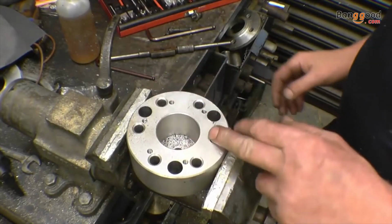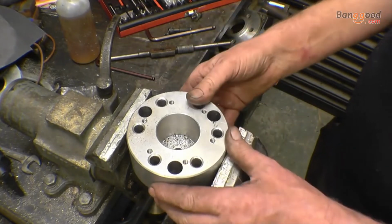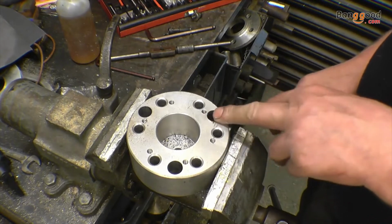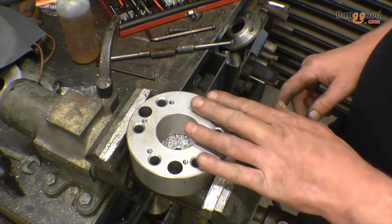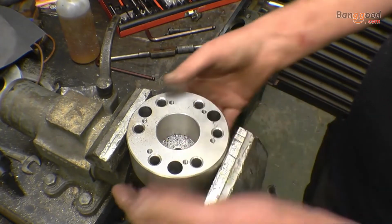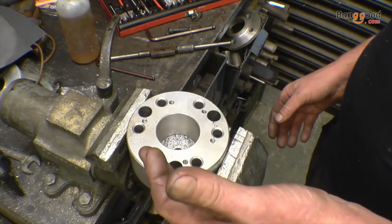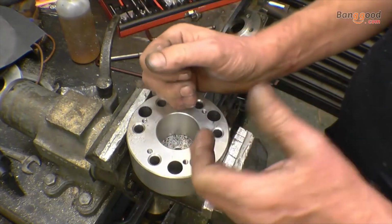I've got a flange here and they're 6mm holes. 6mm is very, very popular. 6x1. It's really important that that hole remains parallel or square to that face. This could be an engine block or a gearbox casing, something where it's important that that's square to the job. So it's no good sort of guessing.